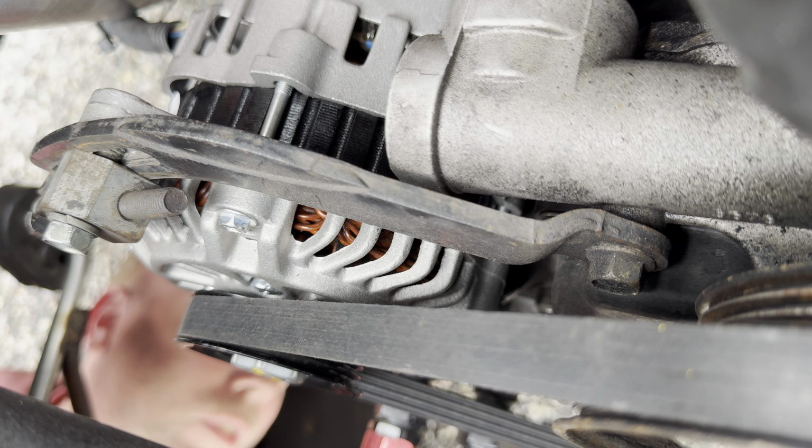And most important thing, let's see if these lights flicker. I hope not. I hope I fixed the problem. Because normally the alternator was 14.8 and 15.3 up in that area. So let me turn this around. We're gonna see if we can have a cure. I don't know. Hopefully it doesn't do it. I turn the wheel a little bit.